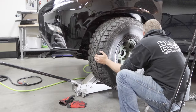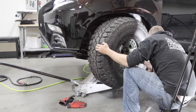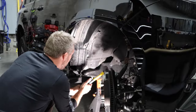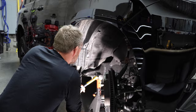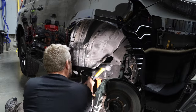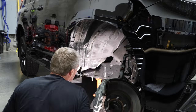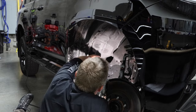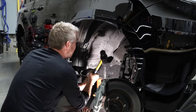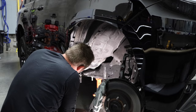After the body mount chop, you put your tire back on, make sure you're clearing that body mount, and then you're going to find a new problem: the sheet metal on the backside of the fender. Your next step is to take about a 10-pound sledgehammer — maybe even a 20-pound if you can find one — and just start hammering right there. Keep hammering and hammering; this process took me three-plus hours on my first go-around, and after my test jumps I came back and had to do two more hours. It was the worst part of this whole project. Make sure you do not hammer too hard at the very bottom where the body mount is, just in case, to avoid breaking that sheet metal open. Otherwise, go as hard as you can — if you've got buddies, this is where you call them to help.